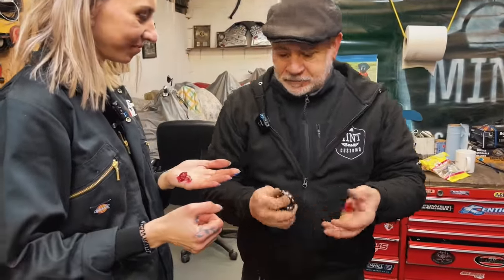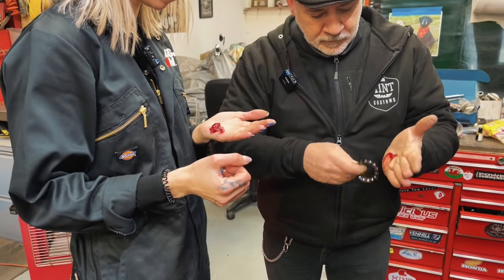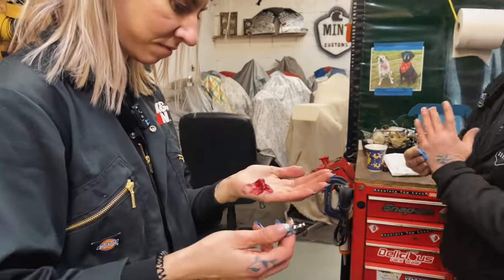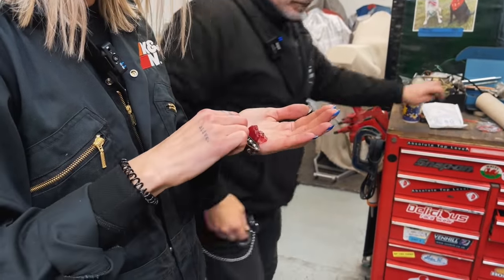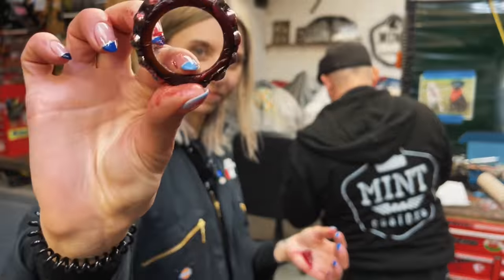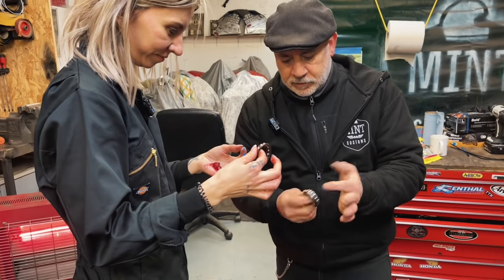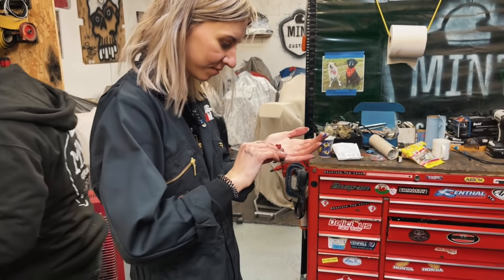This is how you pack a bearing. Okay. Like this in your hand? Mm-hmm. Roll it round. Yeah. Packing a bearing means making it greasy. That's too much, isn't it? You've got another one to do in a minute. Yeah, I think it's packed. You happy with that? Looks delicious. Same with this. Like that, pack the grease in, flip it over, do that side. This is an apprentice job. Apprentice job? Yeah. Okay. Pack the bearings.